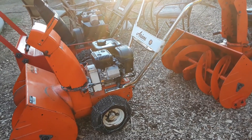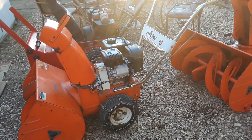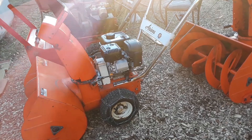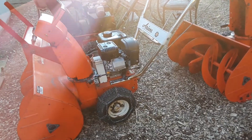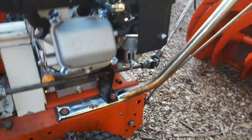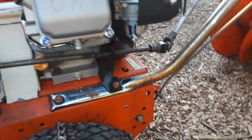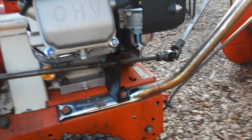The thing with that is, if you go to different altitudes or the engine runs at different temperatures, you may still need to adjust the carburetor, and that would mean changing the jet all over again. Well, with this adjustable main jet, you won't have to. You'll just be able to adjust it to the proper altitude and temperature every time.